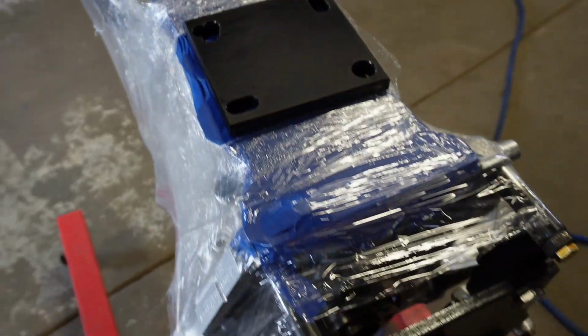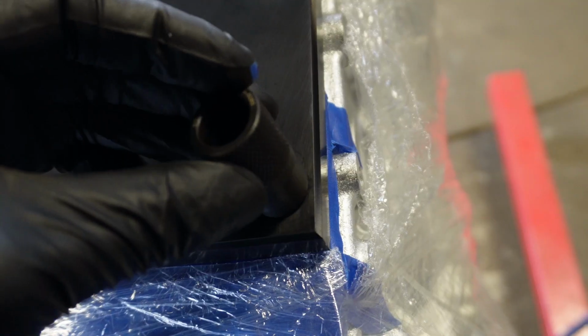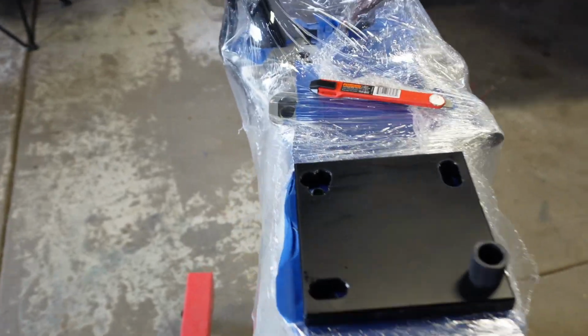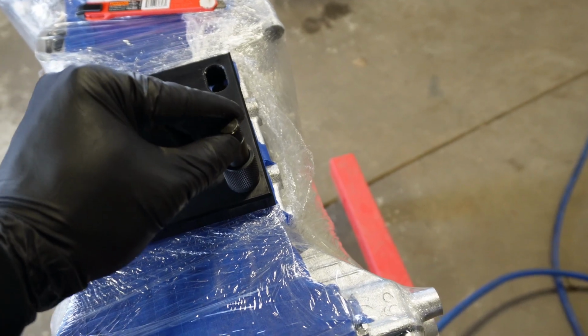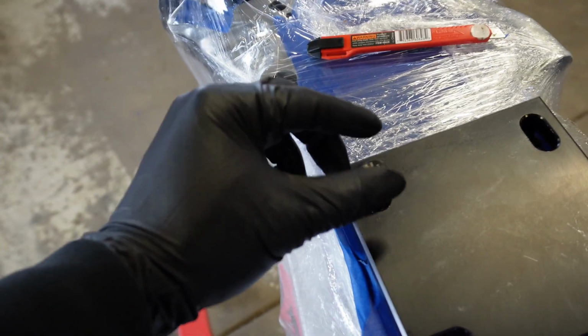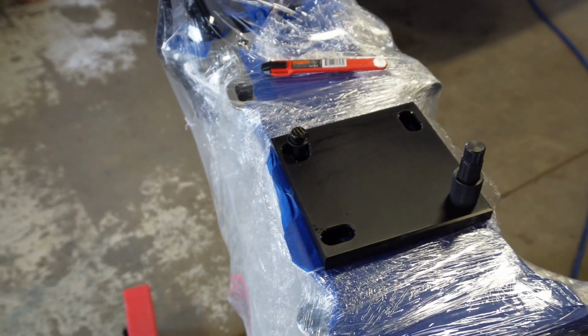Everything is going to be slow motion. If I even have a hint of something falling down in that motor, I'm going to take it all apart and go over it. So I'm going to put this bushing down. Now that bushing goes in there, and that's going to be your stop for your drill for the depth and everything. This is the lineup pin here, goes down in there. You find your hole. Once you center your hole, you take the assorted hardware and bolt that baby down into place. Do the corners, then you're good to roll.